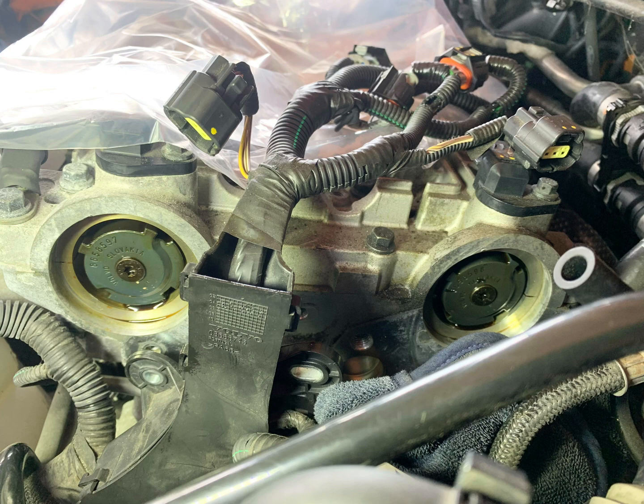These are extremely tight screws that are put in with Loctite from the factory, and you're extremely likely to strip them or snap Torx bits, and I snapped 2 of them. The way that I found to get them out, people will tell you need impact screwdrivers or an impact and all this stuff. The way that I actually found to get them out was I had to heat them up with just a lighter, heat them up for a good few minutes, and then slowly with just a 1/2-inch drive ratchet, I turned them off with a Torx bit. I still managed to twist my Torx bit by hand getting them out, but this is an extremely difficult step.